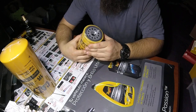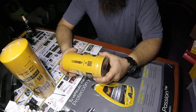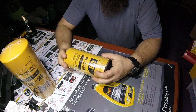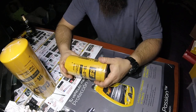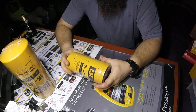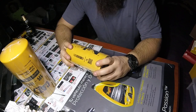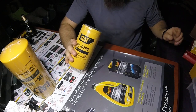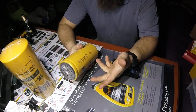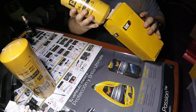base plate. I mean, this is really nice stuff, and there's not even really all that much pressure that goes through this. Design spec for a transfer pump is usually less than 100 psi, usually like 70 or 80 is normal for this type of fuel system, and this thing is way overbuilt. So again, I got extras because I figure this versus being on the side of the road, this is a lot cheaper, a lot less headache. So I got a couple of those.